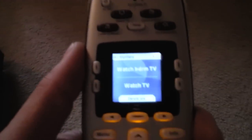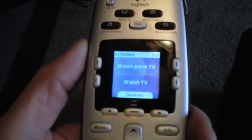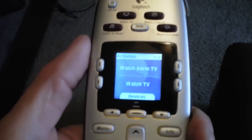Hit the All Off button on the top left and it turns everything off. Thanks for watching — post a comment and subscribe if you have any questions. If you have this remote, let us know in the comments whether you like it or hate it. To program this remote, go to myharmony.com, plug your universal remote into your Mac or PC, enter your email and create a password. It'll send the Logitech program to your downloads folder or desktop — extract it, go back to myharmony.com, sign in, and plug in your model numbers for your devices and activities, how your devices are connected to your TV and surround sound, and what inputs they use.